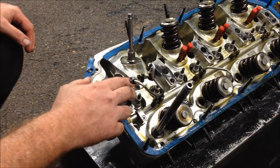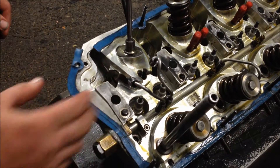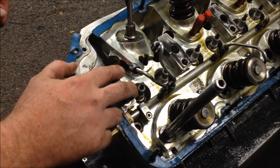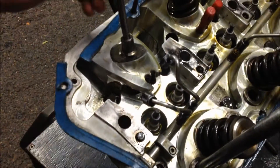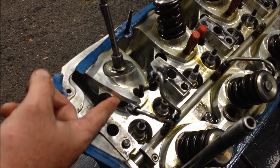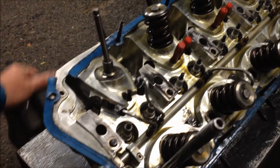Nice job to hide - we've got too much rev as it's got up on the tyres. The rod's broken, and as it's launched off the line it's hit the valve, pushed the valve back. As you can see, it's quite loose in there - it's hit the valve, popped it backwards, and pushed the valve out through the tappet cover.